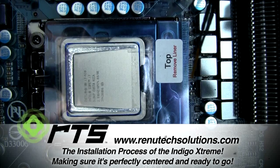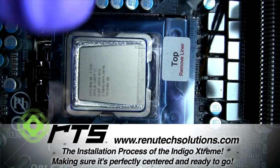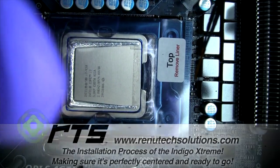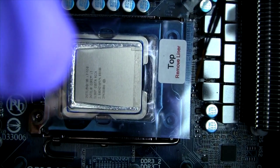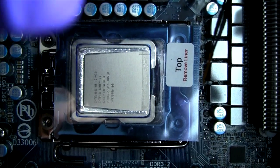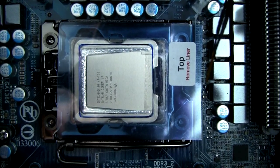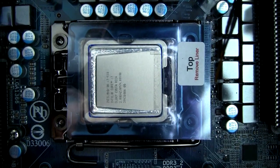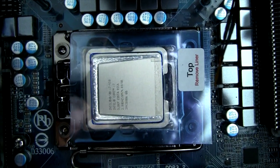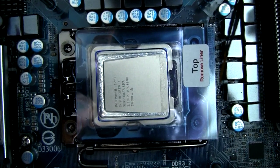It's on. I finally got everything aligned, and I did that U-shape — as you can see, from here all the way around. I did it on the thicker side, whereas the gentleman on MaxiShine did it on the opposite end. I guess you can do it either way, but I followed the instructions. There's so much you can easily miss — it's not like regular thermal paste where you just put a dab. This is a process, and right now I'm just in the beginning stages. Let's get the water block back on and get this thing cranking.